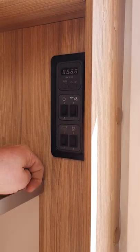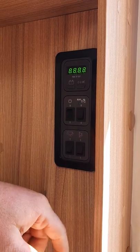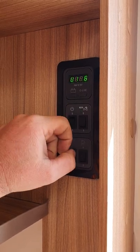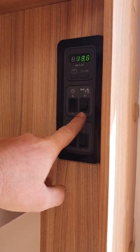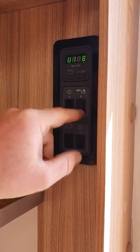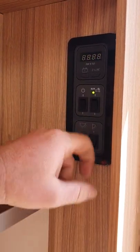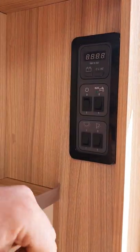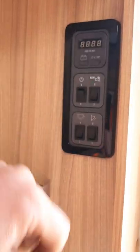Just inside your door, between the door and the microwave, is your main 12-volt system. You've got a master switch that turns on and livens up your 12-volt system. The small left button tells you the current voltage of your battery. Down beside the master switch is your water pump switch — fill your water caddy, hook up the pump hose, then come in and turn the pump on.